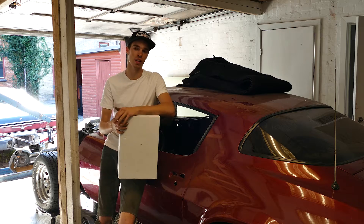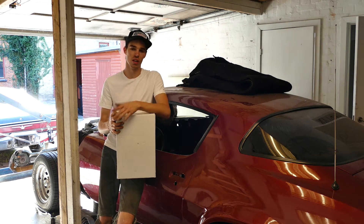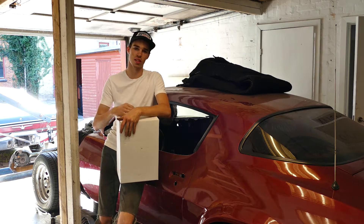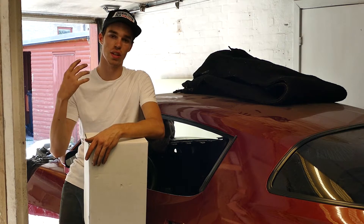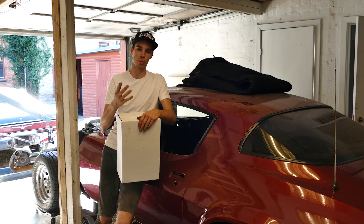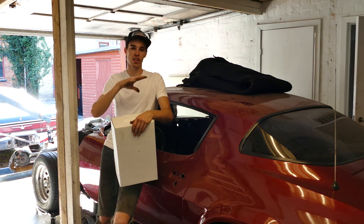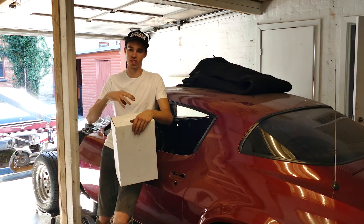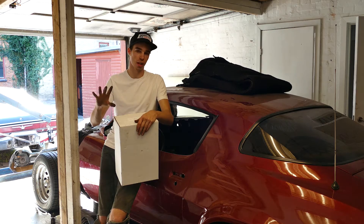It's a really awesome product that basically allows you to completely digitally tune your ignition for old muscle cars. You're going to download the app to your phone and then you can adjust everything — from vacuum, if you're running a boost application, to a little bit more timing at a certain RPM. You can adjust every single thing; basically an entire tuner app for your ignition on old model cars, which still comes in an old distributor platform.